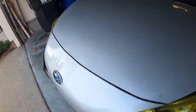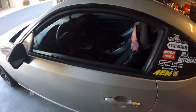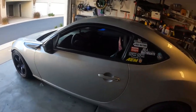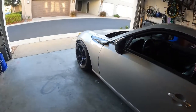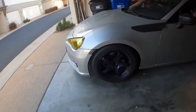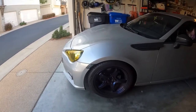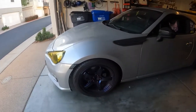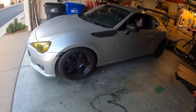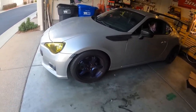It's tuned on an OFT. It's mostly the stock OFT E85 Stage 2 Plus tune. I haven't changed a whole lot about it, but it does have a little bit of crackle, and I did do some rescaling of the MAF for the new intake because the OFT tune is for the factory intake. So the intake scaling took some testing, but it does feel a little bit faster than the regular off-the-shelf E85 Stage 2 Plus tune. Not by too much, but it's a little bit peppier.